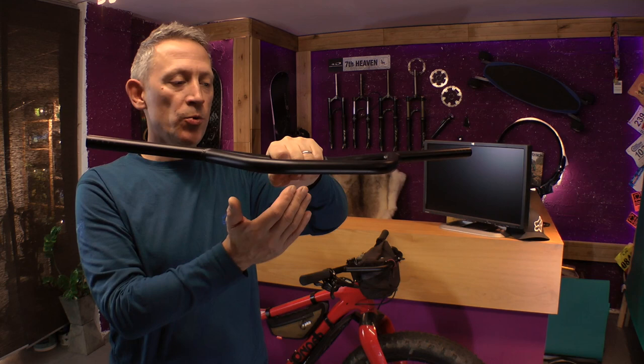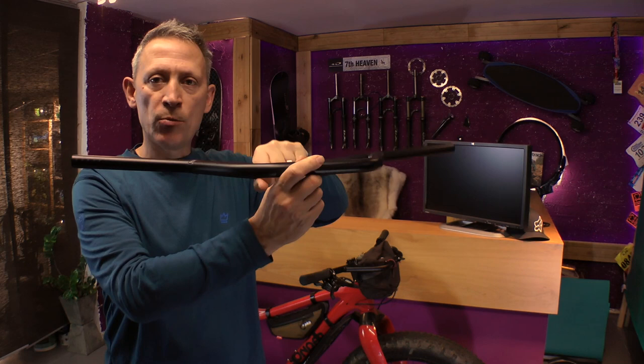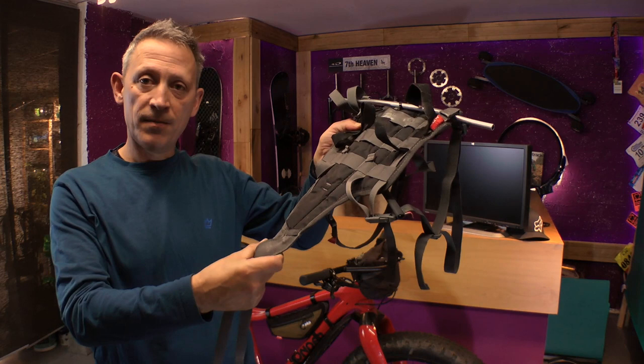While we've solved one problem with the bike — moved the bag away, protected the cables, and the stem from being scratched — we've created another problem. Moving the bag out here creates a rotational force. With the best stem bolts in the world, done up as tight as they can be, weight jiggling around and bumping over single track and baby head rocks is going to cause the bar to rotate.